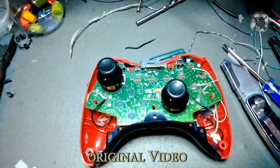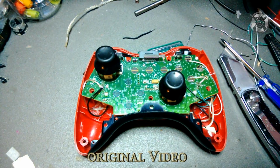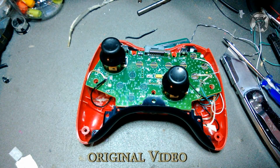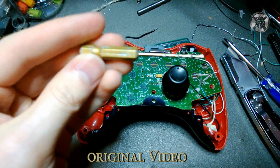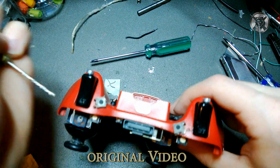That's another thing. A lot of people ask me, what size drill bit do you use on the holes when you're making them? There are only two drill bits you use. Let me see if I have them sitting around. This is one. This is a 5/64. This one is to make these itty bitty holes up top. See those? This makes those.